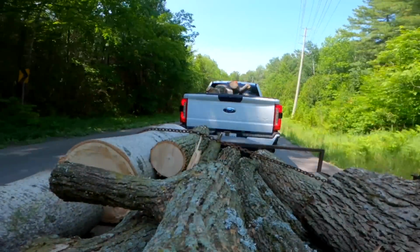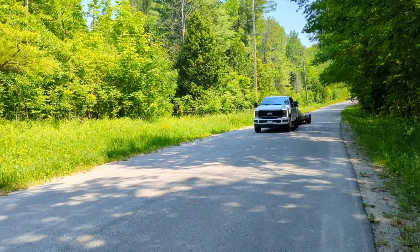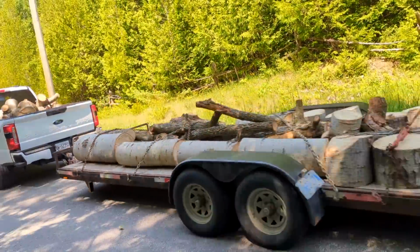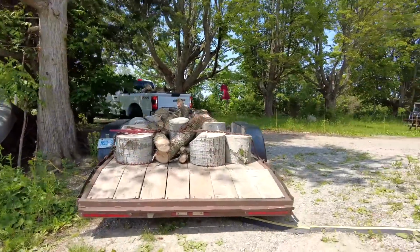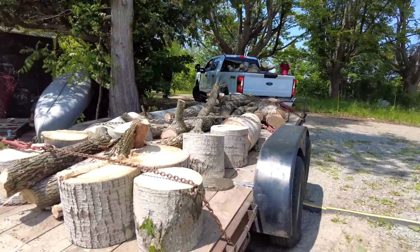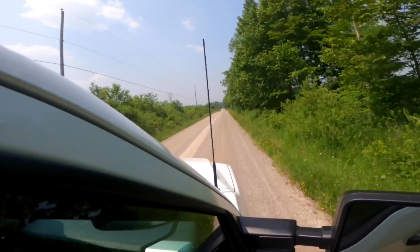And I just want to throw one thing in here, because you mentioned the Godzilla engine, and I understand that from your way of thinking, you're thinking that this engine was built for the Super Duty exclusively, but that's not actually the case, because Ford supplies a lot of chassis cabs as well as RV chassis. And for the longest time, they had a V10. That's gone now. And when that went away, that's what the 7.3 was for, to replace that. So the 7.3 goes into all those van body cutaways, utility vehicles, ambulances, various other things that they sell to people, and to the motorhome industry. And Ford sells a lot of chassis to the motorhome industry. So one more option for them too. Exactly. However, the 6.8 made more sense for pickup trucks, because the 7.3 actually is hauling a hell of a lot more weight.